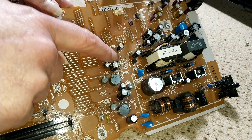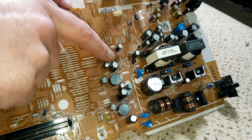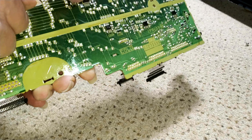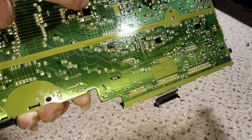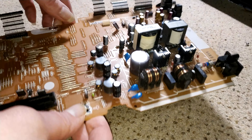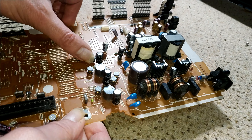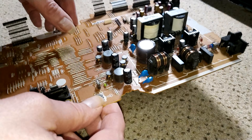Interestingly, you'll see there's a browner part of the board here, which suggests heating. You might wonder why it's hot there — well, it's because there's a voltage regulator on the bottom with a heatsink. Heat rises anyway, but it's mounted straight onto the PCB, so it's causing quite a lot of heat in that area, thereby making these caps leak. That's what'll be causing that.